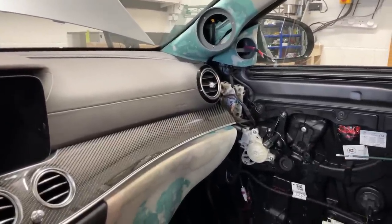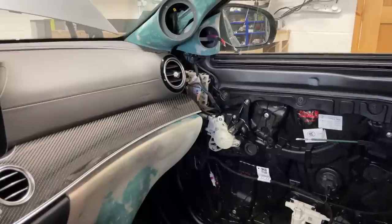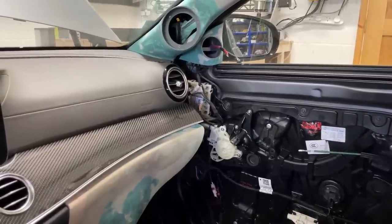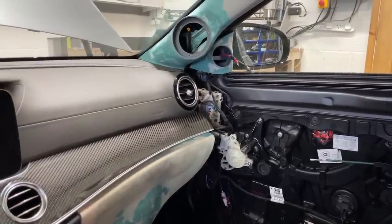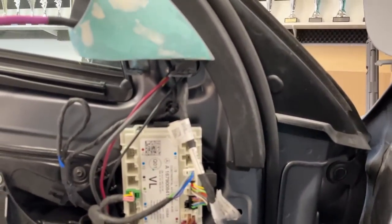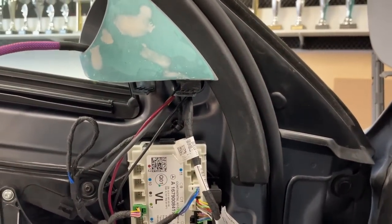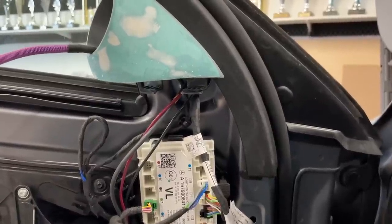You don't see the door card in the car yet because taking the door card in and out millions of times is just not practical, because those sail panels cannot come out without the door card in place. I can show it from here, they have these tabs underneath the panels, and once you put the door card on, the door card locks these sail panels in place.